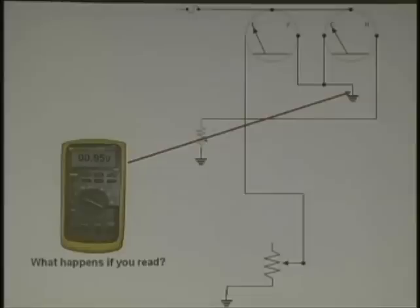You know when you drive down the road and you see that truck or car coming at you and one headlight is dim? You think it's the feed side or the ground side? I bet money that it's the ground side 9 out of 10 times. Because someone took that screw and over-tightened it and now it's a little stripped. When you start pulling on it or it gets corroded, the ground's not good, and it's not going to work right.